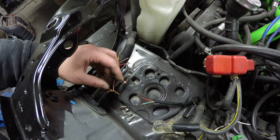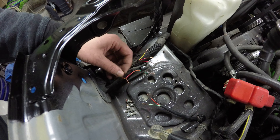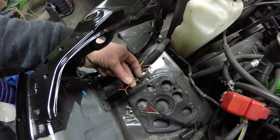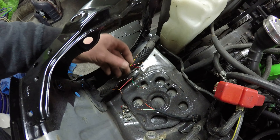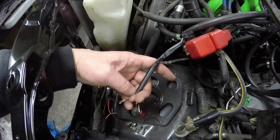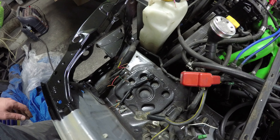As for the turn signal and park light it's a little different because the little corner light on the outside — you've got to stick that wiring through. It's a red with yellow and a black. The turn signal connection on the bug eye is a black, red-and-yellow, and a black with green tracer. Just by looking at the connections on the blob eye light I was able to determine you can splice the two grounds together, put the green with black tracer to that wire, and the red-and-yellow to red-and-yellow, and black to black — that should just plug into the blob eye light and work.